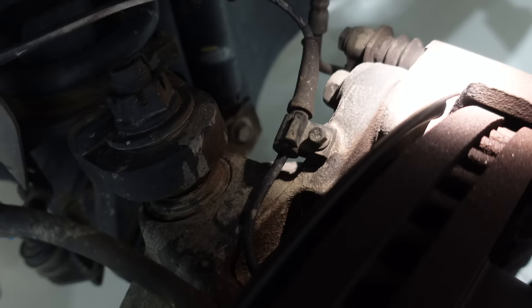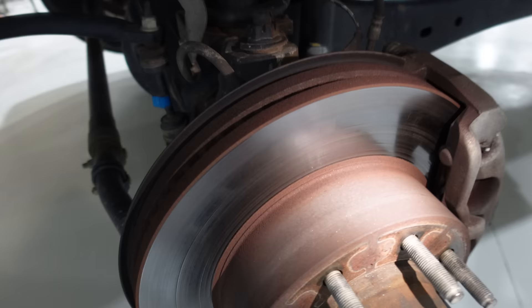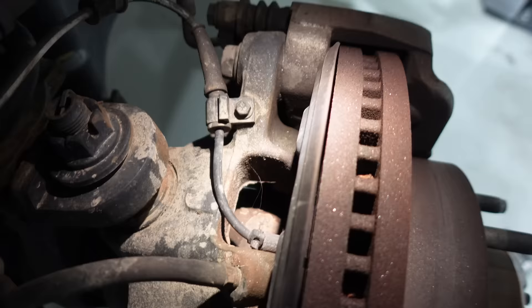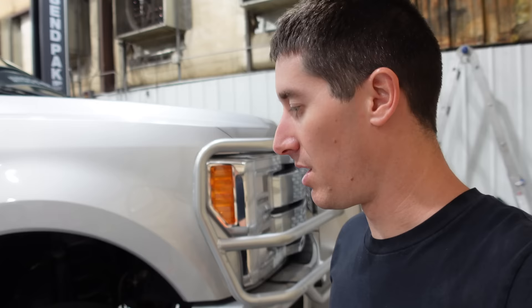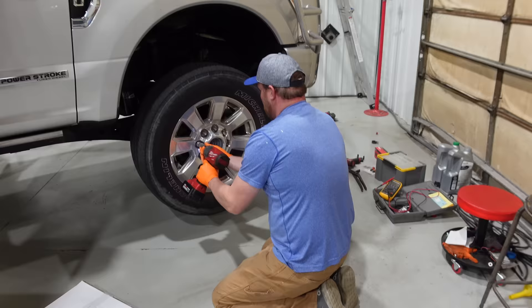Okay, you can see some metal on there — the fronts have almost no brake pads left, just a hair. Down in there there's maybe a tenth of an inch. On the back somewhere it's grabbing metal but there's still a little pad — I don't get it. The back is definitely where you can see glistening metal, but the heat checking on the front is outrageous, and that's been there since I bought the truck.